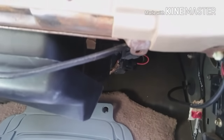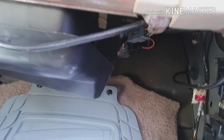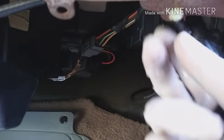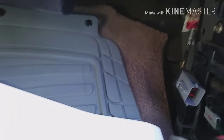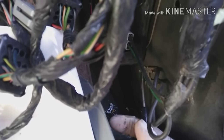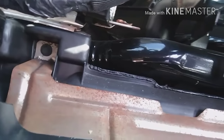The antenna cable runs along the bottom of the dash — you're going to unplug that connector once the dash is removed. For now, just unplug the plastic clip holding it here to give yourself enough room. Also, you have to remove this ground — it's a 5mm bolt — because you have two bolts, one and two, holding the dash to the frame.